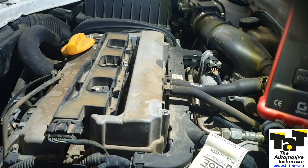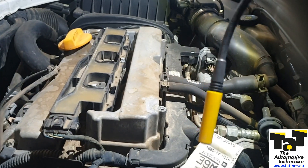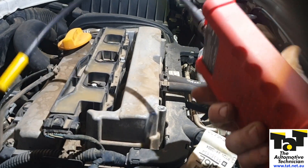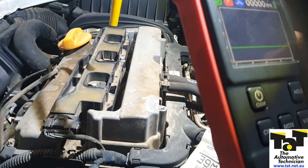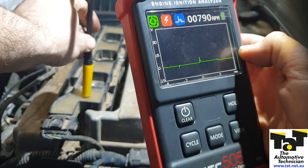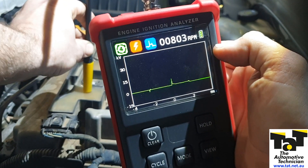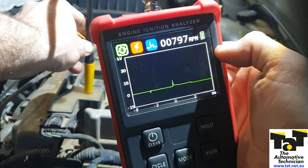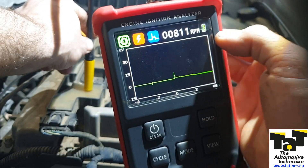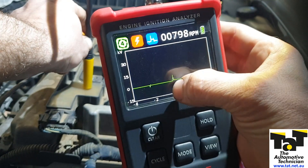I give the guys a bit of an idea of what they're looking at. If we look at the voltage, the KV buildup — that's what we had when we booted up. So I'm on voltage, and we're just using an inductive pickup that's on the end of the tool. I get my little antenna down here and you'll see we now have a waveform. I've tried this against the scope and it comes up pretty well. That's what we're getting as far as a KV reading.